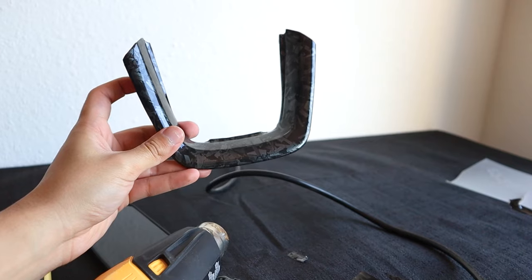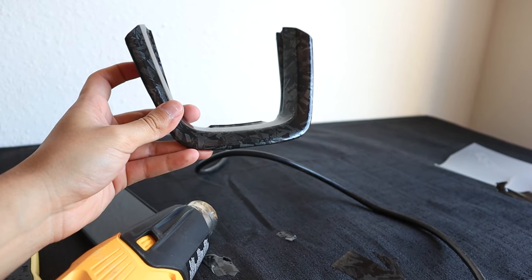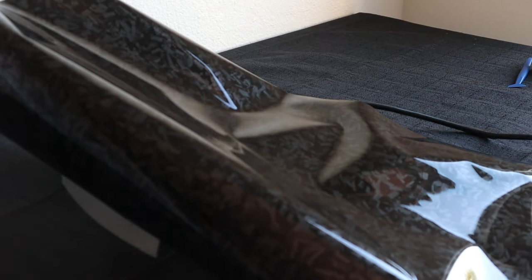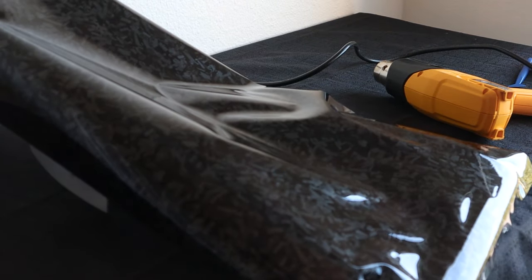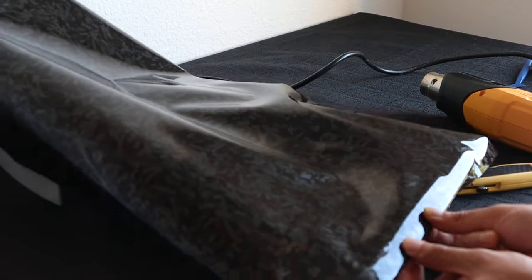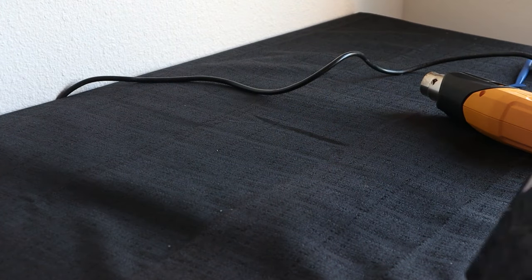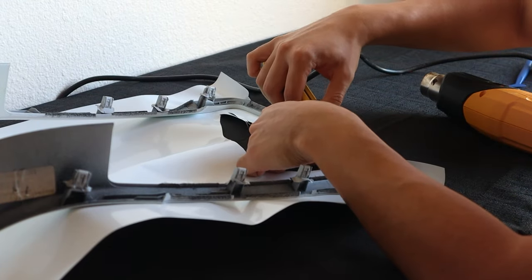You can see just how glossy this piece is. While I'm not a professional, all the areas that could theoretically be better are going to be on the underside or taken out of the equation entirely. The next piece is connected to the last one and goes around the infotainment system. I'm starting by laying a small section of vinyl at the top, then peeling the backing off the rest so it lays down really nicely and orderly, pressing it smooth with no air bubbles. Then you flip it over, do relief cuts, and fold it over to hold everything in place.